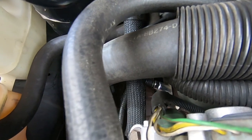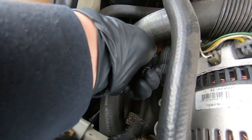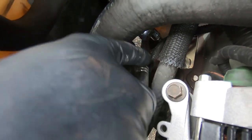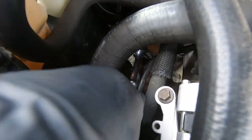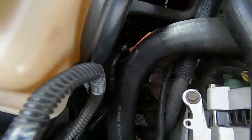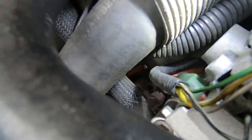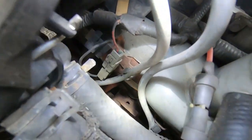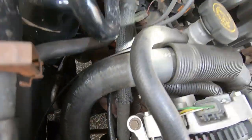I have that finger tight, I'm going to grab the socket wrench and snug it in — that should be more than enough to get this plug snugged into the cylinder. Sneaking on in here, I got my socket wrench in, barely moving it — barely moved it, got it tight. Should be nice and tight in our cylinder. I can go ahead and pull this off. That is now tight in our cylinder, and all I have to do is take the wire, guide it back on, and press it right back over the plug.